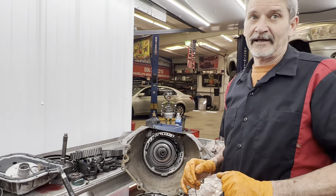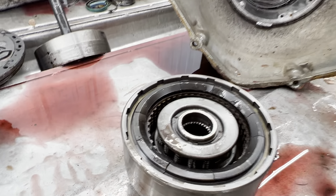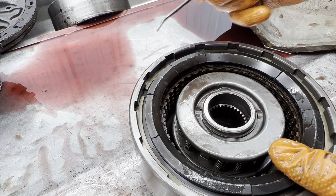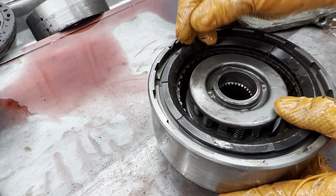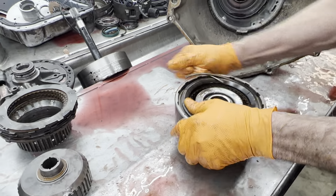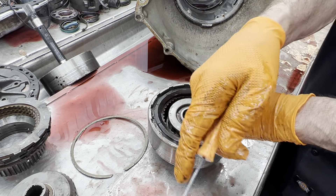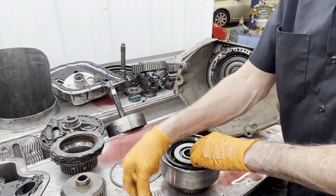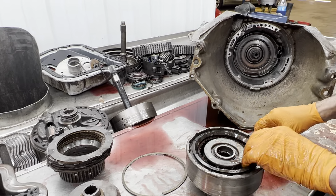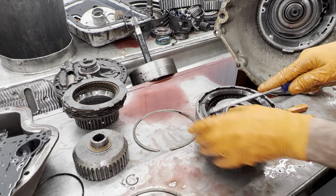Major high pressure — and if you look at this, what do we see? This backing plate has seen better days, it's in pieces. I'm surprised it's still together. It was kind of blown out — gaskets being on wrong, anything like that can cause this issue. It didn't have a big boost valve and spring or anything like that, it has stock physically 400 pressure. But when you take the modulator off it gives it all of it, you know, even in reverse.